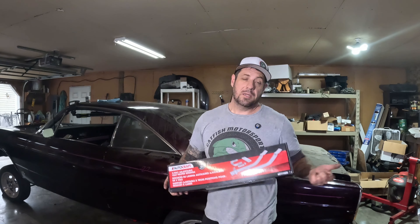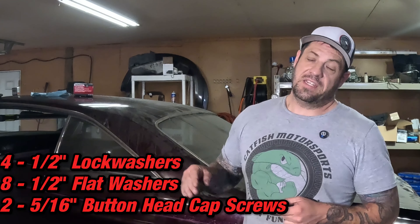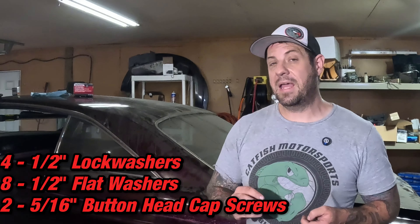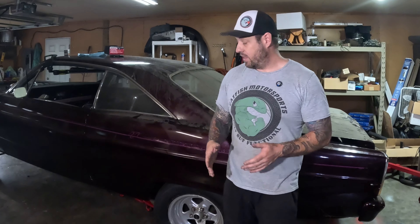That's project complete. Here's the parts list real quick. The part number for the kit is AC111020, made by AutoCraft. Because we had hardware issues, I wouldn't blame you for trying to find a different brand. If you do still want to go with this kit, here's what I'd do: go to your local hardware store. You need four grade eight lock washers for a half-inch bolt, eight half-inch flat washers (two per nut), and to replace the rivets — if they send you flat rivets like mine — 5/16th button head cap screws will work to mimic a round rivet. We did get an inch and a half of lift out of a $40 kit and a few dollars of hardware. Hopefully watching this video saves you a store run. Please like and subscribe if you haven't already — we'll see you next time.